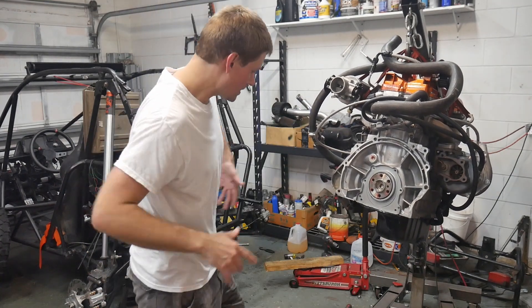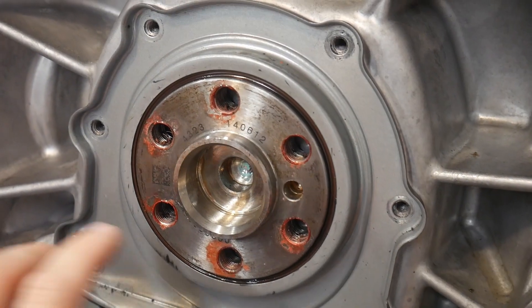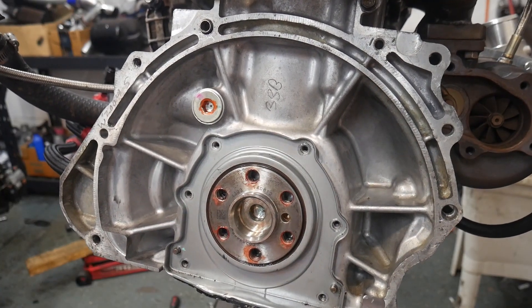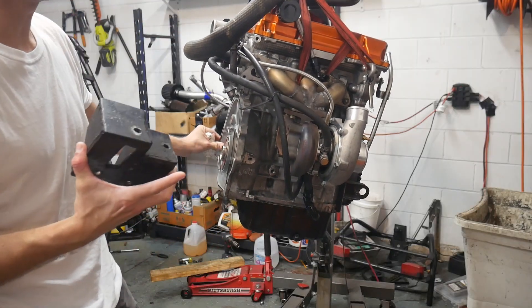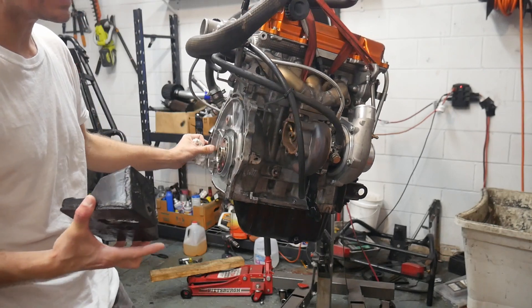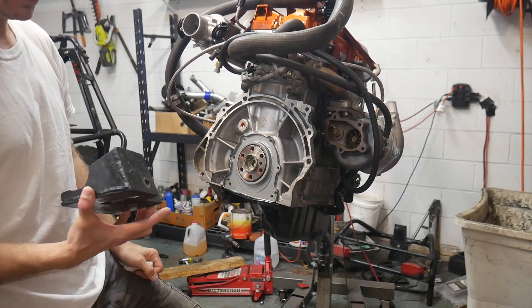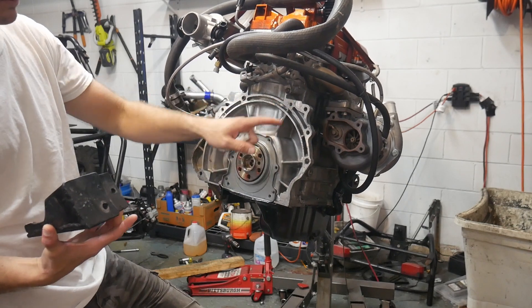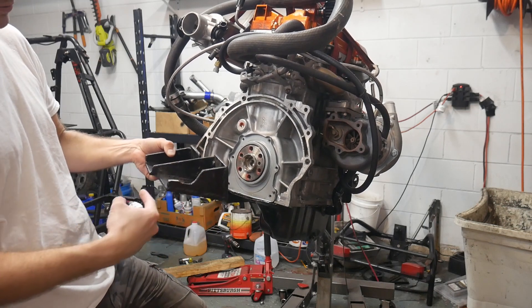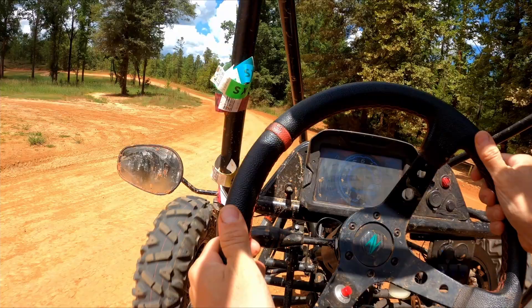Now that the engine's out, there are a couple of things we can fix. First, it had a small oil leak — you can see oil down at the bottom there — so we'll get that seal replaced tomorrow or the next day. Also, you guys know from my previous videos I did testing with turbo blankets and determined they make a substantial and considerable difference in your spool time. So I'm going to put another turbo blanket on the system. I wasn't able to do that before because of the engine mount, but we're going to figure something out to get it under the turbo with the blanket in place.